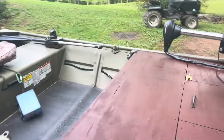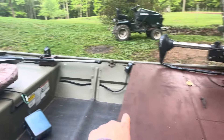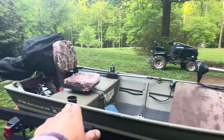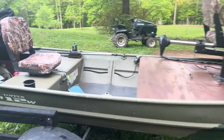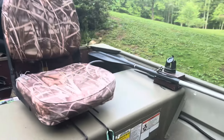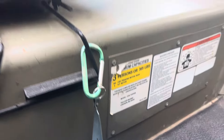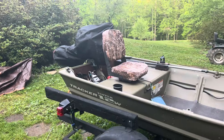So under this board there's a middle kind of seat, like a green bench seat. And I had one of those seat brackets on it, and then there was a little boat seat right there. So you could have one, two, and then three. However, I started doing some math on the weight of this boat, and I looked at the capacity sticker. Now this boat is weighted for 480 pounds — that's people, motor, and gear — and that's counting a five horsepower motor.